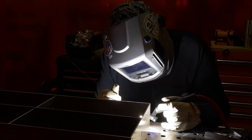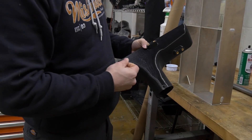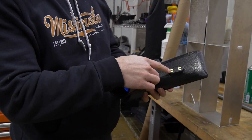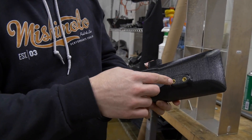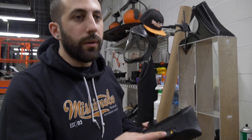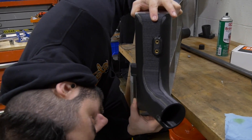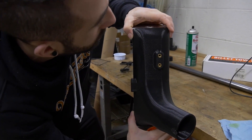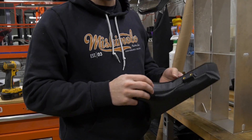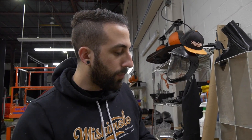You can see Mike already fabricated this core. Before I put this all together, I put some threaded inserts in. These just heat up and melt the plastic around them. I could also thread this, but I like these inserts. They look very professional and are proven to be a lot stronger than just threading the plastic itself. Depending on the application, I'll just thread it, but for this, I'm putting these in.